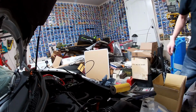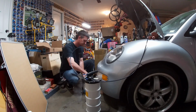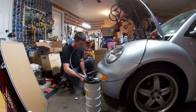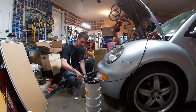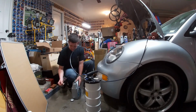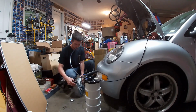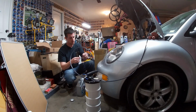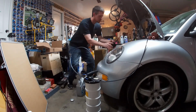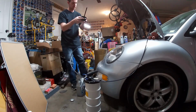Now one trick that I like to do is I take the new oil and I like to lubricate the O-rings as they go on. Everything's always slippery. You take your screwdriver, wipe off the end, and use that to puncture. Peel that foil back, take that off. That can go in the garbage box. Set that back down. Tip it just a little. You get just a little on your finger. Doesn't take much. You kind of just slide it around until it doesn't have that dry look anymore. Once it's a little bit glossy, you take that big O-ring, put it back down, slide it around and over the threads, back down into its hole.